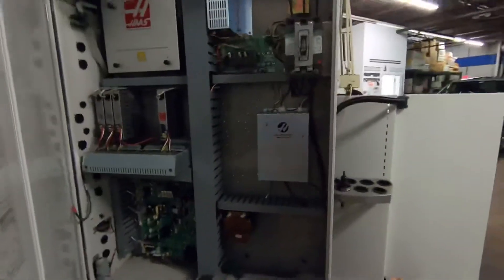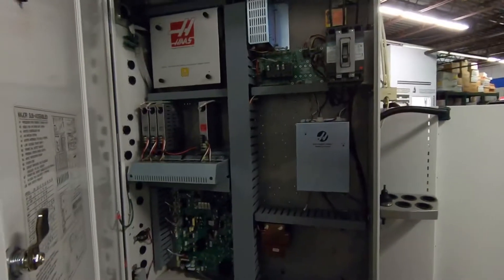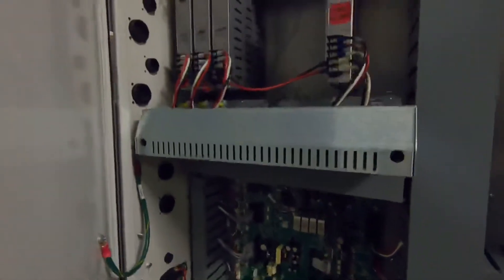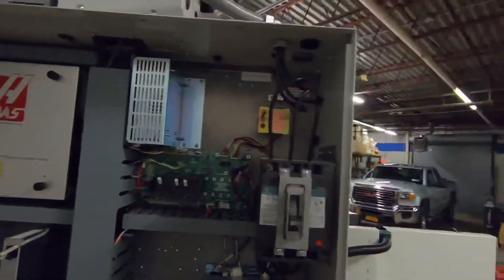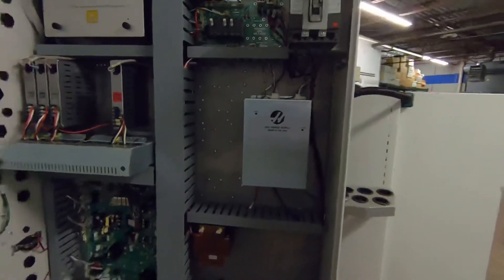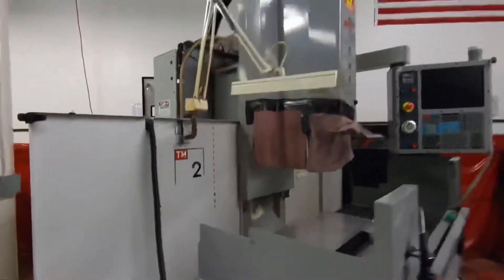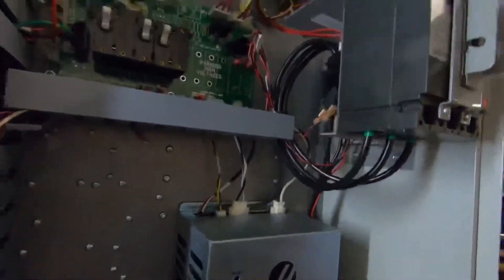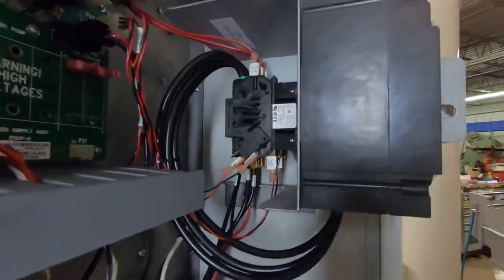So how are we going to test that? Carefully, carefully. Just a couple things in here to show you guys — another transformer down there, couple big boards. Famous words of the employee: 'worked last time.' Alright, so what we got going on — you guys all heard it, it wasn't firing up. On the back side of your main breaker, obviously make sure it's off at the breaker panel. On the back side you have your contact switch here.